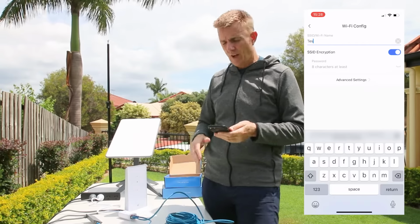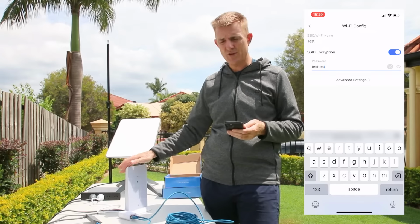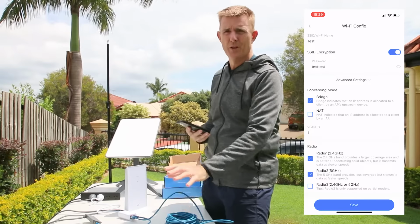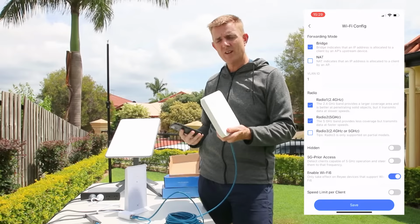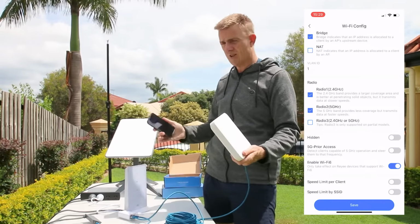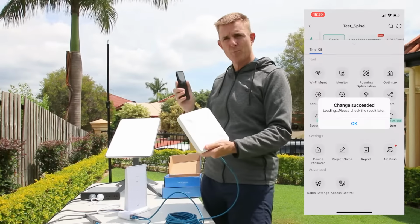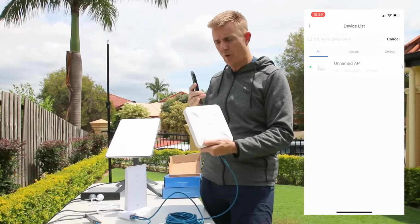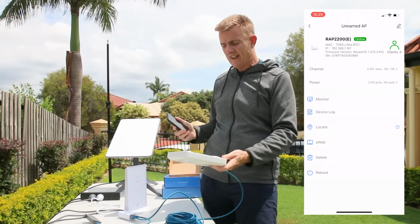Because we're extending this Starlink router, we are using two different technologies. So once your phone or your laptop is no longer within range of your Starlink router, it will hunt for the next access point, which could be your Ruijie that we've set up here. It will try and renegotiate. It's not ideal because it's not the same manufacturer, but it is a solution that's going to work for you. So probably we want to match the SSID in our Ruijie Cloud to be the same as our Starlink router. And really, that is it.